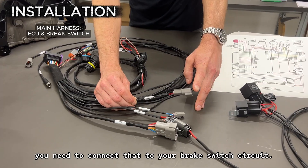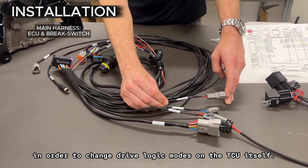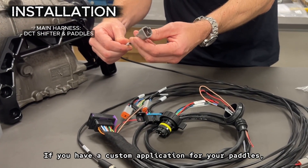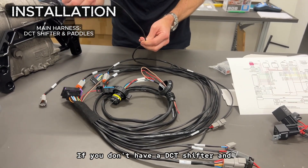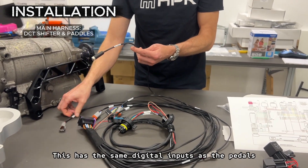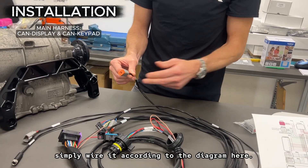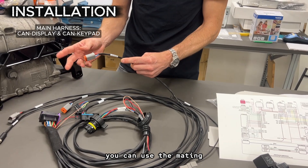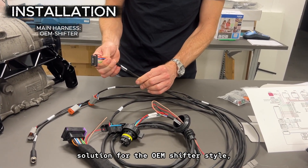The same with the brake switch — you need to connect that to your brake switch circuit. There's also an additional wire that can be connected to a drive logic button in order to change drive logic modes on the TCU itself. The DCT shifter is direct plug-and-play, and the paddles are also direct plug-and-play. If you have a custom application for your paddles, you can find the wiring schematics in the wiring diagram — it's one ground and two digital inputs. If you don't have a DCT shifter and wish to run any other micro switch buttons, you can simply cut off the connector and use those same digital inputs. The CAN display plugs directly into any CAN display, or if you have a custom CAN display, simply wire it according to the diagram. The CAN keypad plugs directly into the Blink Marine CAN keypads; if you have a custom requirement, use the mating pin connectors and wire it according to the wiring diagram. Here you also have the plug-and-play solution for OEM shifter styles — also direct plug-and-play.